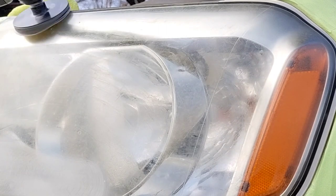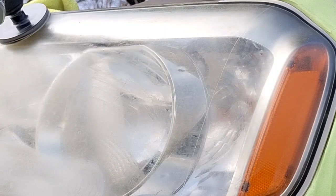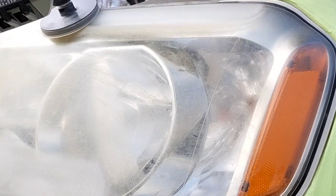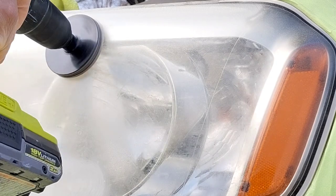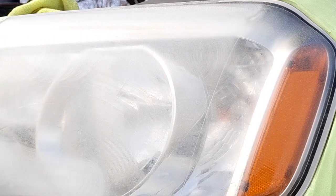Okay, so there's two major things that cause these rings and cause the degradation of the headlight to just keep going on worse, and why I'm using a 320 and why it's always harder to remove the surface of the headlight when people are doing polishing or multiple levels of polishing, okay? So basically, there's a bunch of thick embedded residue on top of the headlight or embedded into the surface of the headlight. Because when you look at a headlight under a microscope, most polycarbonates resemble a sponge.